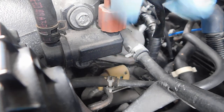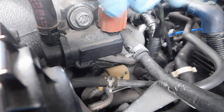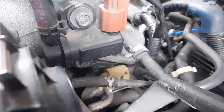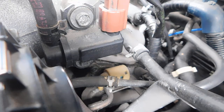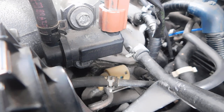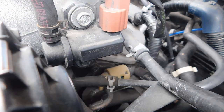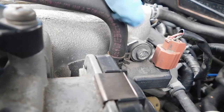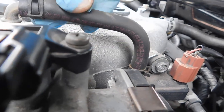This is the purge solenoid, and the solenoid purges the evap system. So the gas cap thing doesn't hold enough pressure, because of this line here. This line here sometimes gets clogged. So check this line here if you get that